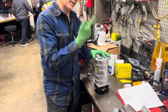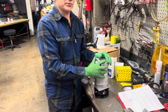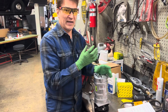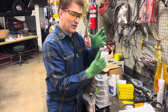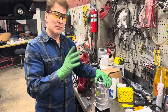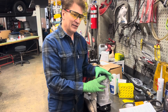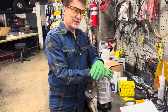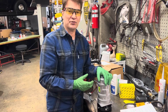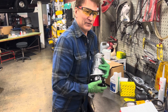What you preferably want to do without spilling oil on yourself is remove the pressure by removing the cap. Even though they're brand new — especially remanufactured — do not trust them. Spin them and train yourself how different compressors feel. You're looking for a tight spot. If you feel one particular tight spot somewhere on that 360 degrees and you feel a stiff drop, that is not right. Most compressors should not have a real tight spot. Some compressors like the old Harrison five-cylinder with tight clearances would be very tight brand new, so you're kind of screwed on that one. But look for anything that feels unusual.